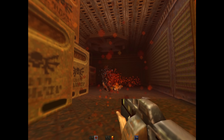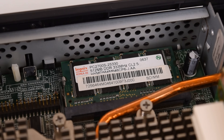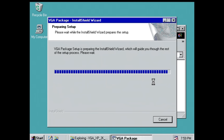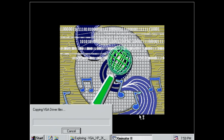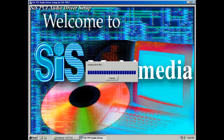With the other two thin clients we had issues with Windows 98 SE, so let's see how this machine fares. I downgraded the RAM to 512 MB for better Windows 98 compatibility. The installation process was slightly different: I used a USB floppy drive to boot from a Windows 98 boot disk, partitioned and formatted the SSD, made it bootable, then copied the Windows 98 installation files from my desktop and ran the installation on the thin client. For drivers I installed the AGP chipset, graphics, sound, Ethernet, and USB drivers.